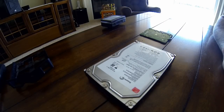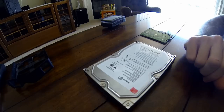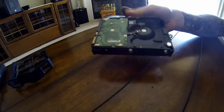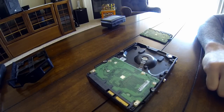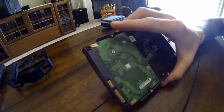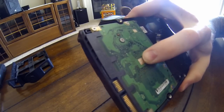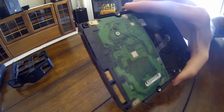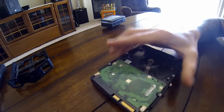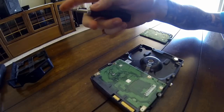Since we're not able to hear any clicking noises, it doesn't sound like there's actual damage to the moving parts on the inside. So what we're going to do is replace the PCB that controls the hard drive. If you look closely on the other side, you can see right here it looks like it got burned a little bit, or maybe part of the board is fried. This is common when you're running them as a RAID 0. We'll go ahead and take this off and swap it out with a new one or used, as long as it's working.